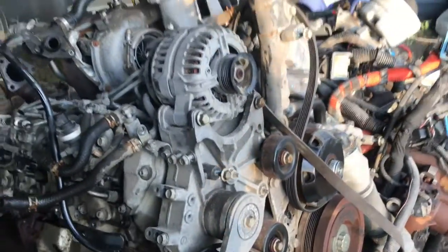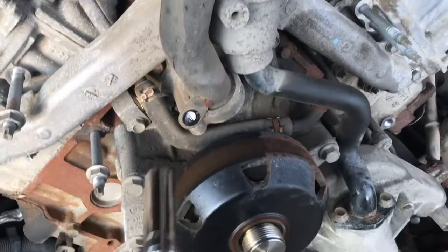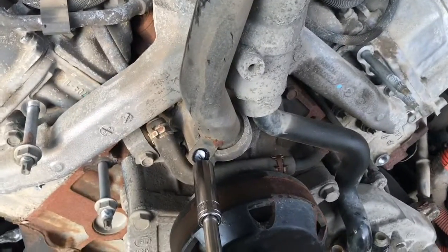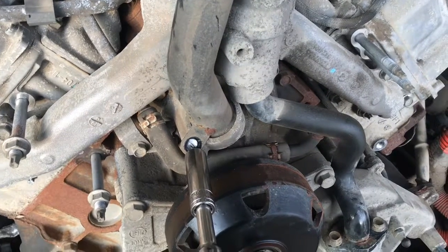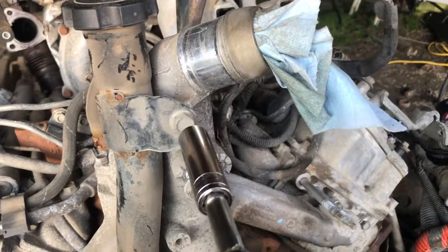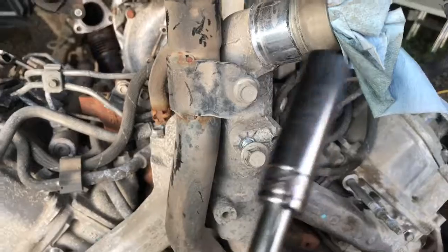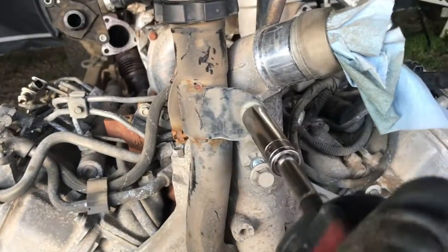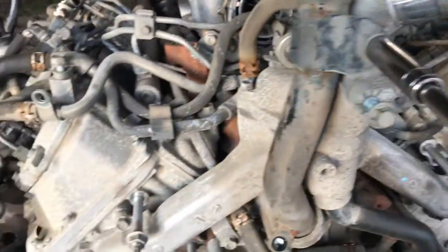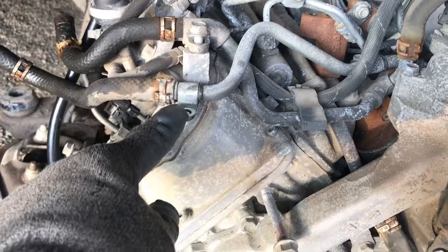Should open the front end up a lot and make it look a little cleaner — or a little more comfortable despite GM stupidity. This bolt holding the oil filler tube down is a number 10. Up here on the top side, holding the oil filler tube on so it doesn't wobble, is actually a 13 — I even tried 12, it didn't fit. Then over here, this fuel line holder was a 12, and up here is a 13.